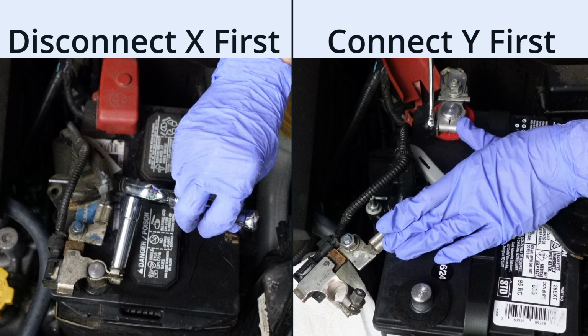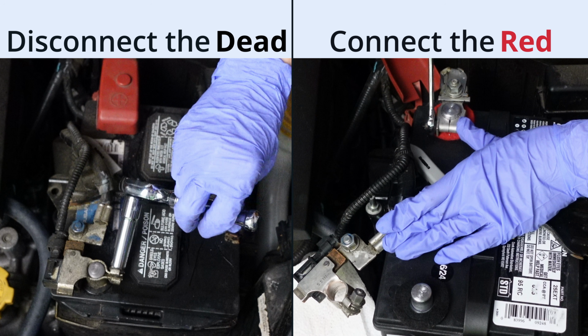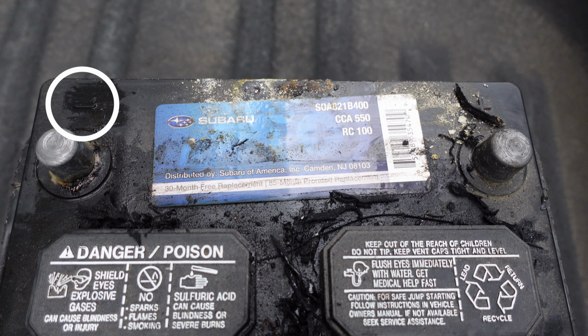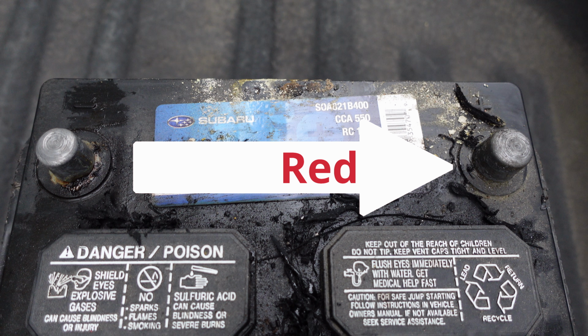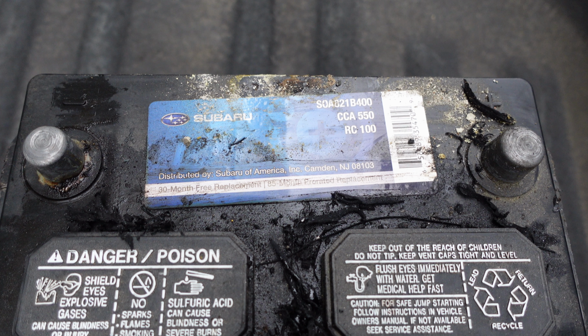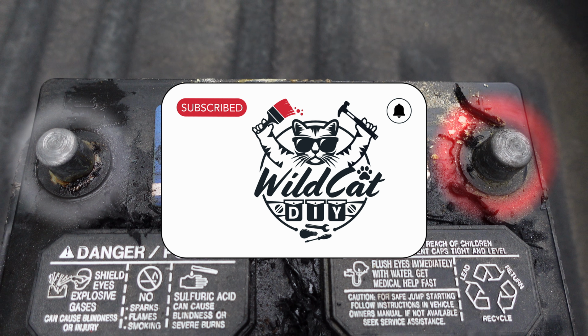To remember which terminal to disconnect and reconnect first, we could use the phrase, disconnect the dead, connect the red. The dead is the negative terminal, which serves as the ground, while red refers to the positive terminal that delivers power to the car. Comment below if you have a way of remembering which terminal to disconnect and reconnect first.